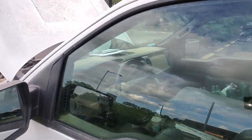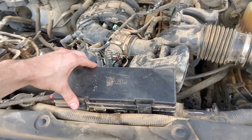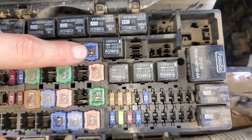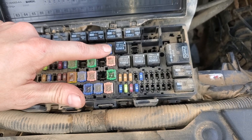Make your way under the hood first. Most of the fuses are going to be in here. The fuse box is right here — pop it open. The first one for you to check is going to be this 20 amp J-Case fuse right there. That is going to be for the power outlet in the instrument panel.